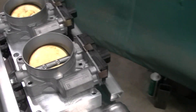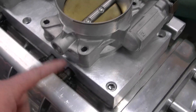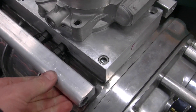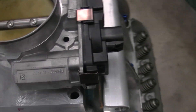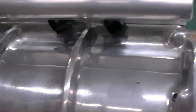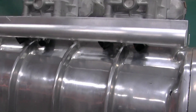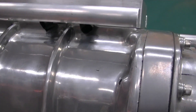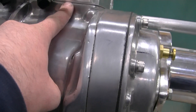It should be no biggie getting them in. They turned out real nice despite that one mistake where I drilled the injector hole in the wrong spot. I'm not 100% sure I'm going to use these LS7 style injectors — I may go with a little bit longer injector. On this side I can flip these around so the connectors come up here, but on this side I can't because of the throttle body — they're in the way if I flip them around. They do go underneath nicely though; I can run the wires under the injectors and they all split out there nice. I may have to do a custom blower restraint plate, which is not a big deal — I've done them before. The restraints usually come out about here, which would be right in the way of my injector, so I might make them come out up here and over here instead.